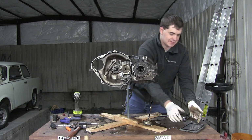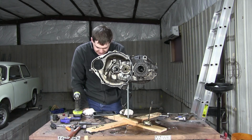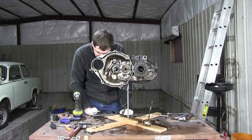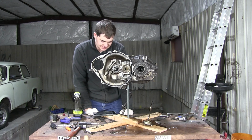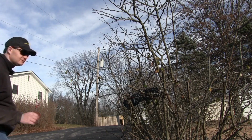Alright, let's see what the manual says before I go whacking at it with the happy-go-lucky stick. Remove all the fastening screws from the casing. Done. Use 2 screwdrivers and lift the casing lower part at the lugs cast on for this purpose. During this operation, the shaft should remain in the casing upper part. Well, this one's interesting. Draw out the speedometer drive from the bush.